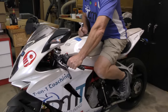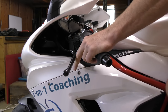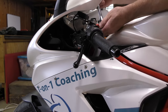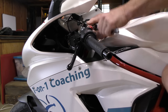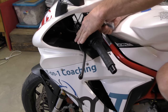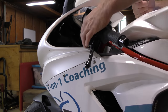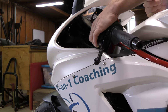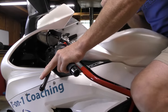Setting your clutch lever correctly — the same thing applies from the grip. Do you have to move your hand backwards to get your fingers clear? Yes, because otherwise I'm doing this — I have to do that to do that. So this has to be lowered. After adjusting: that's too low. Better. Now everything is straight down my arm all the way through my fingers, so that's fine where it's at.